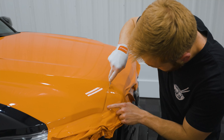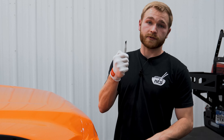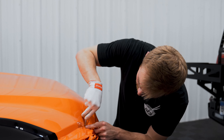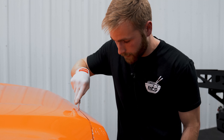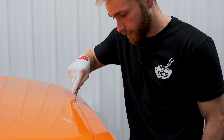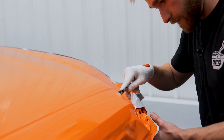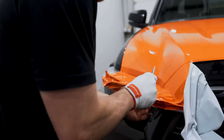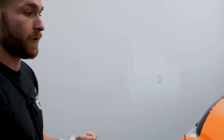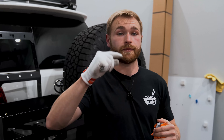The last cut we need to make is along this grill surround. You want to be cautious here because there is a gasket — use very little blade and very little pressure, and all you're doing is using the grill surround to follow. Be sure your blade isn't snagging on the gasket or any plastic, and cut away from the car. For the front two edges near the headlight, I do like to lift the hood first and then trim on the underside because the headlight gap is a bit odd.